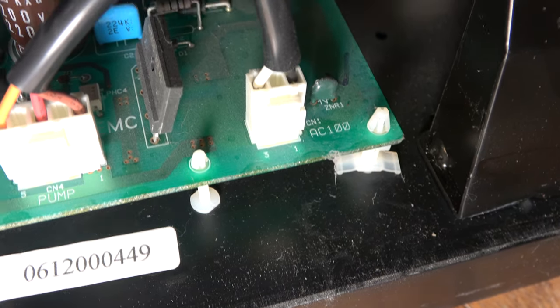You can get into the situation where it's powered up but the display's off and you don't know if the machine's on or off and there's no indicators. So I fitted an LED here to indicate that it's on, but I deliberately chose a particular kind of LED that quite closely matches the original LEDs on the unit. So it has very much the same sort of aesthetic. It's a flat-topped, small green LED. And when Mrs. Video 99 first saw that, she thought it was a factory install. So it's very much in keeping with the machine.